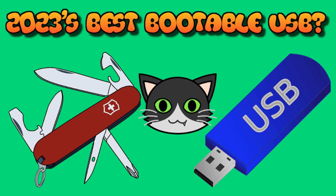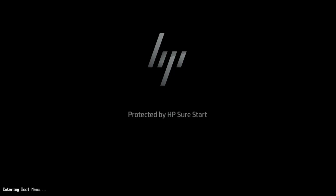Today we're using an HP laptop, so we're going to boot from USB. To do that, we reboot the laptop and hit F9 — though it may be different on your computer, so look up how to access the boot menu. You may also need to get into BIOS to enable different boot settings, but for the most part just access your boot menu and select the USB drive.